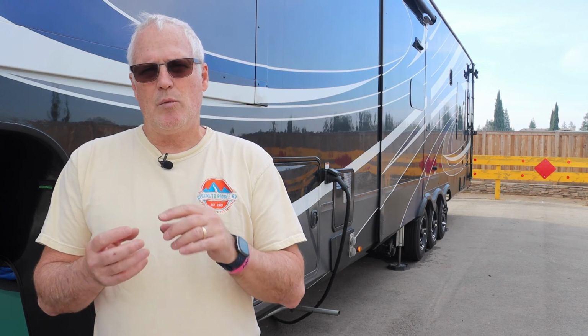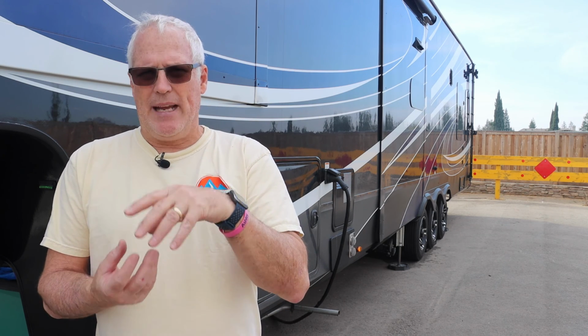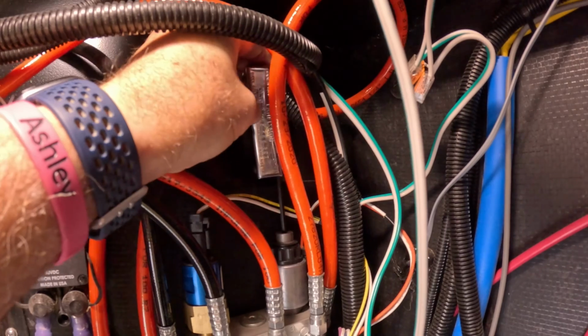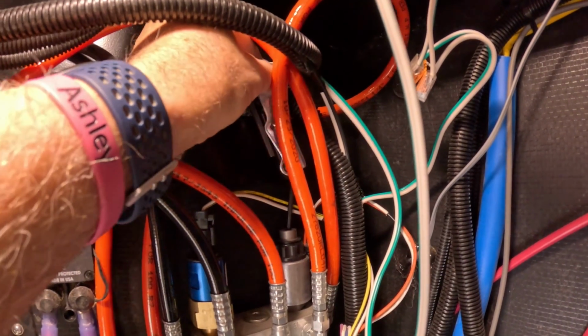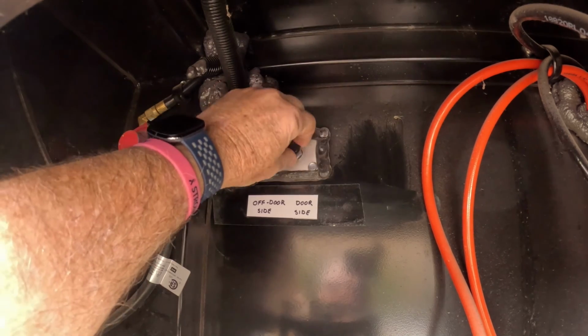Now we're not quite 100% done. There's still a couple things we need to tidy up. Remember on the valve manifold, we manually screwed in or opened up the slide valve. We want to make sure we put that back the way it was, so we're going to unscrew that as well. Then also on our IRC controllers, right now both slides are closed, so we're going to open those up to get everything back to the way we started.